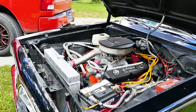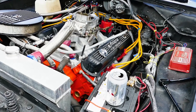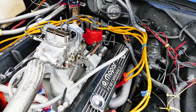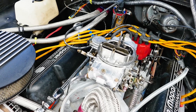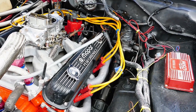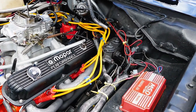It's a 340 block, original 340 from '69, and I made it into a 372 stroker. They don't make pushrods for this so the pushrods had to be machined and made — not hand-machined but custom fabricated. It's got roller rockers with solid lifters — that required additional machining. It's internally balanced; the crank is internally balanced. I-beam forged connecting rods.